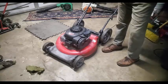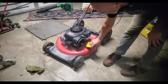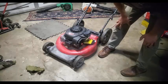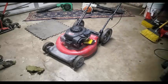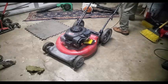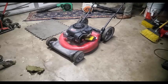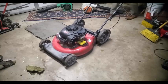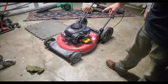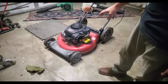If it didn't do that little bit of trying to run, I would take this air cleaner cover off right here — there are different kinds of air cleaner covers — and down in the lower hole, you just spray some starter fluid in there and see if it'll fire. If it fires but then dies real quick, that means it's able to run but the carburetor is not allowing fuel to flow properly through into the engine. What I'm planning on doing is pulling this carburetor off real quick and showing you the common issues, what happens, and how to clean it. It's really quite simple.